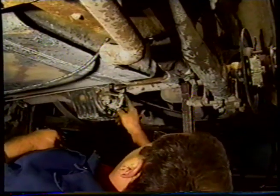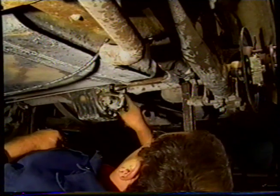Before we can set up the rear brakes, we need to take the compensator rod out that goes to the servo indirectly. So we'll take this pin out and then we'll be able to set up the adjustment in the drums correctly. Now we have that one off. What we can do is put our expander rod back in. Pins are nice and long, make them easy to bend.